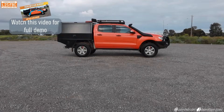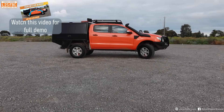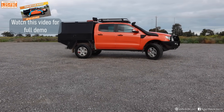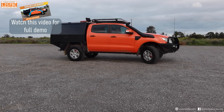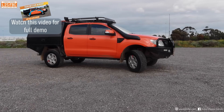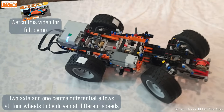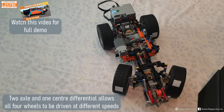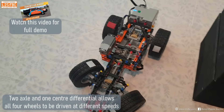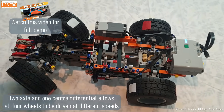Take a look at the red marks on my wheels and see what happens as the vehicle goes around the corner. You can see that the front wheels are travelling quicker than the rear wheels, and the same is true of the left and right wheels on the front and rear axles. When a vehicle goes around the corner, all four wheels turn at different speeds — and this is why we need centre, rear, and front differentials.